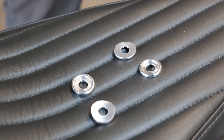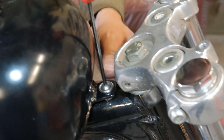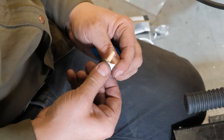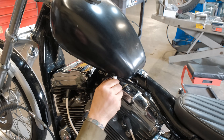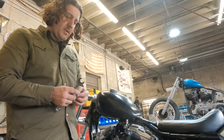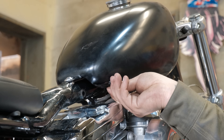We have these finish washers that are good for mounting tanks — they go on the top side. We have a flat version and a curved version because some tank tabs are flat and some are curved, but it gives you a nice solid mounting surface. The last step to getting a running bike with a tank is putting a petcock on. This is our quarter-inch straight stainless steel petcock — real simple to put on. Put a little bit of Teflon tape on the threads and bolt it in. Lots of tanks have petcock bungs on the other side, so we're going to plug it with our magnetic hole plug, which is also quarter MPT.